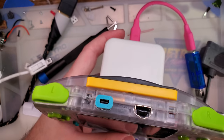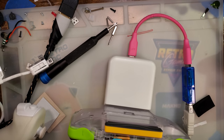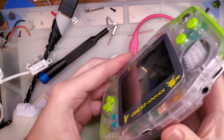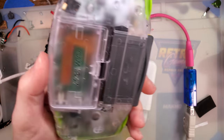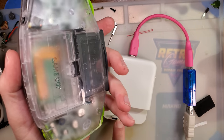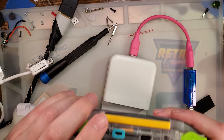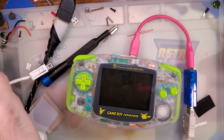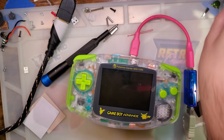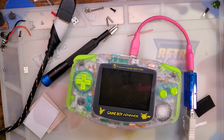They screwed up and didn't get USB-C to C compatibility — literally two resistors, that's all they need. I was about to get angry about how it switched off when I unplugged it, but there are no batteries in it. By the way, you cannot use this with batteries — you have to remove batteries if you're going to use this, otherwise you will reverse charge them. For something like alkaline or nickel-metal hydride, that is a terribly bad thing — you will blow up your batteries. For a lithium-ion mod like the retro modding ones they should be fine, but I wouldn't recommend it. Jugi also should be fine, but still don't recommend it. For the other ones, I don't know enough about how they're wired up to speculate — probably just avoid.